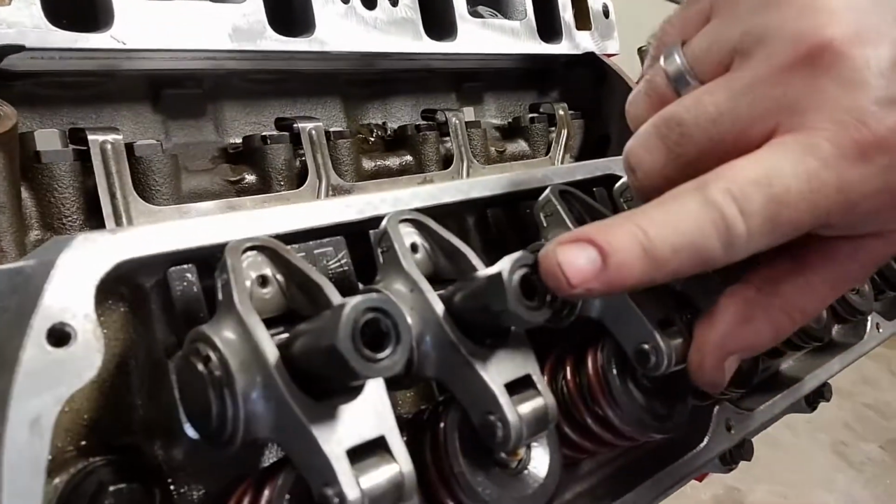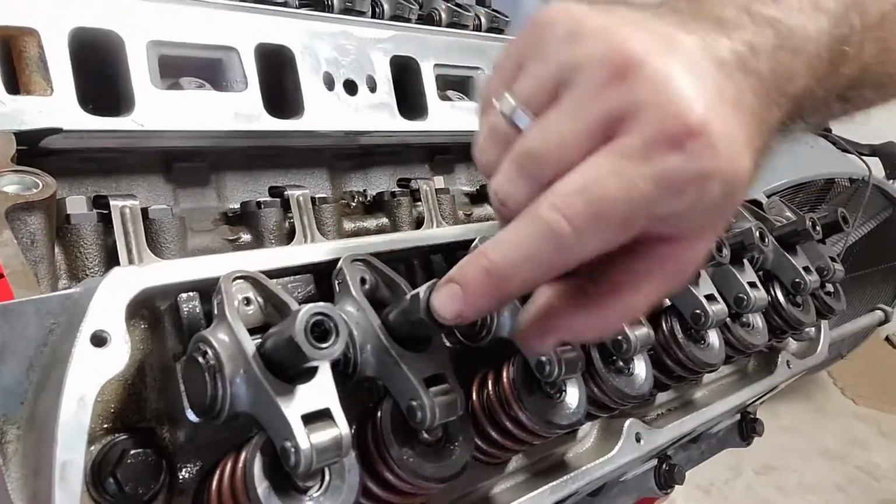instructions recommend. Next is go ahead and get the push rods in it and set the valve lash. It's pretty basic, you kind of get rid of the play and then a half turn past and lock it down. About 25 foot-pounds on the insert, the Allen head inside the nut.